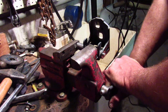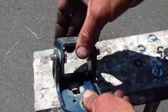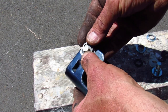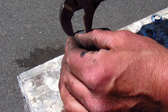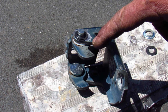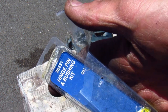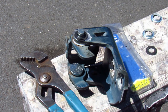That seems to be working just fine, and I think that's about as good as it's gonna get. This hinge feels unbelievably better than it did with the old worn-out bushings — it's tight and it's smooth. All I have to do now is put the little spring washers and retaining clips on; I'll show you just one — and there's the little snap. I'm amazed at how well-engineered this kit is considering it's just a little box full of junk. Thank you, Needa Parts — that's the 38-431 hinge pin and bushing kit, $14.19 at Advance Auto Parts.